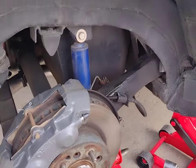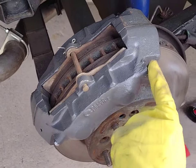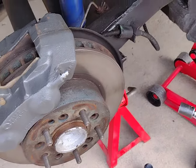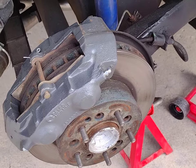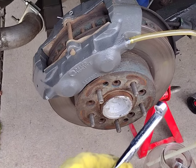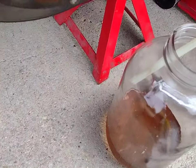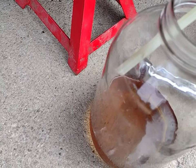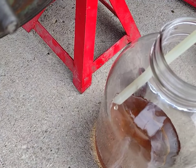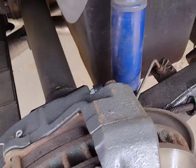It's just gravity at this point. You're going to get a vacuum hose, put it over the end of the bleeder, loosen it up, and by gravity alone it's going to drain. Make sure the master stays filled at all times with fresh DOT 3 brake fluid. We used a 5/16 bleeder wrench to break it loose, then an open-end wrench to loosen it with the hose on to avoid a mess. It comes out at a medium-speed drip. Let it go for a while, then switch to the other bleeder and move on to the next wheel.